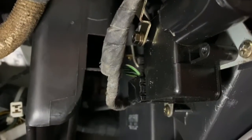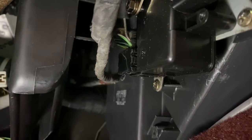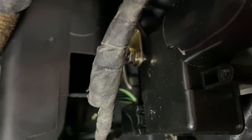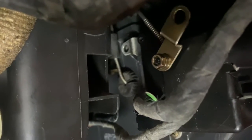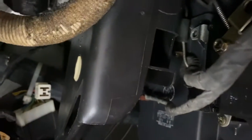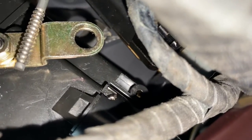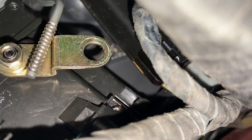Installed the servo that operates the flap, and as you may see it's now operating. So I'm now just waiting for the clip to come. I only installed two screws — one there and one there. The other one I tried to install but because of this plastic cowling that's in the way, I gave up, and it seems quite firm. So I've set the slider to put the flap to the footwell and then it's just a question of installing the clip.